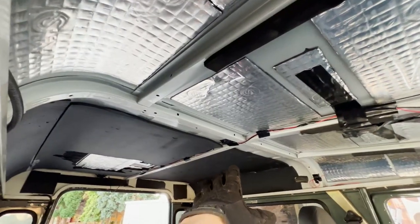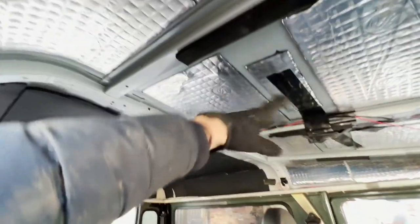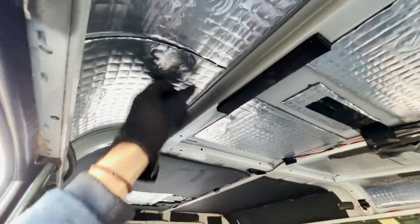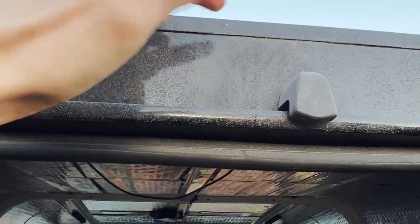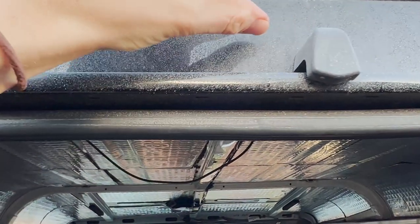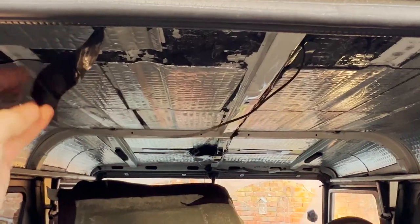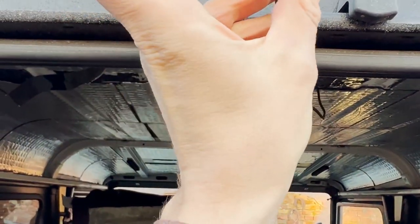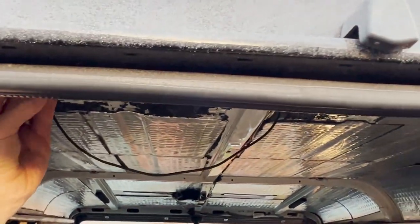I'm going to create a new circuit and get this rear view live mirror fitted. The sound is much much better with the four mil silent coat I've got. I've got my headliners back in the car now; I need to sort this camera out, so I'm going to have to drill a hole through the back of the body, put a little rubber grommet in it so it doesn't leak, and then put a camera probably just about there looking backwards. The camera bracket goes up and will sit just on there, giving me a really good rear view picture.